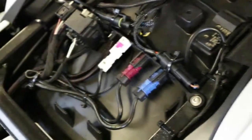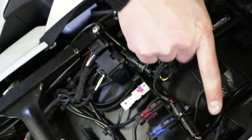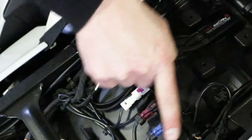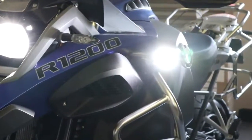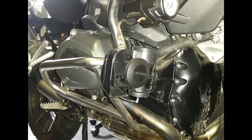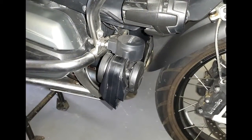Wherever possible, hide the wiring for accessories under the body panels. This prevents damage to the wiring, prevents wiring runs from being too long or too short, and gives a professional-looking result. Also, if the accessory needs to be installed out of sight, consider its size — for example, it may be difficult to fit physically large accessories like air horns underneath body panels.